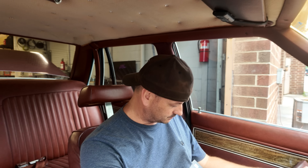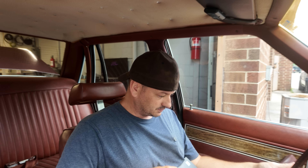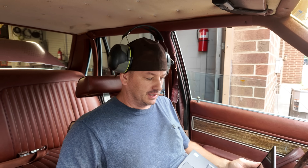All the boost control stuff is turned off. This thing vibrates like crazy. 400. Let's see what the boost was — about 6 psi, and the fueling was okay until about 5500. I didn't rev it all the way out, so I'll make some tweaks and try it again. Before we go too much further I want to make sure the secondary fuel pump is working, so I'm going to test that real quick. Oh yeah, it's coming on. 400 so far seems a little low. Sometimes late nights I just cry. I may have started with the timing way too low, so a little timing and some fuel tweaks — try it again.